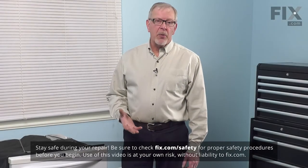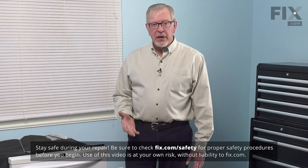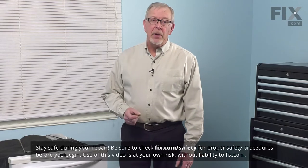Now to do this repair, we will need to pull the dishwasher at least partway out of the cabinets. It'll have to come far enough forward that we can access the back frame on that dishwasher. In most cases, your drain hose and your inlet water line will be long enough that you should not need to disconnect them. However, you will need to disconnect the power since you will be working near some electrical circuits.